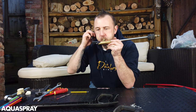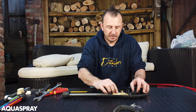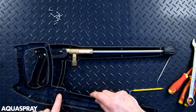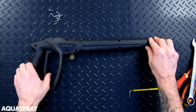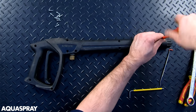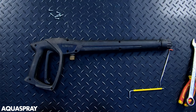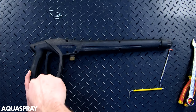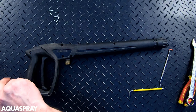If you feel up to it, you can test it. So slotting it back in - you've got to make sure that these two nipples here fit into the gun sides. Make sure that the gun trigger feels like it's going to work, and then just screw these back together. When screwing these up, I always try to do it from one end to the other corners so you know that it's not going to trap anything. Just make sure that everything feels flush - if it doesn't feel flush, then there's something wrong and it's not in there correctly.